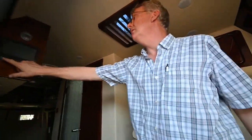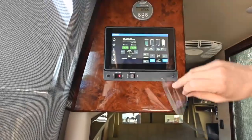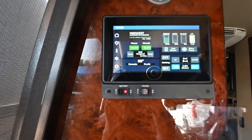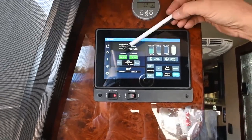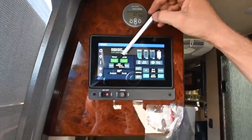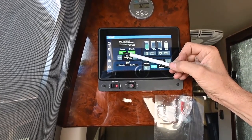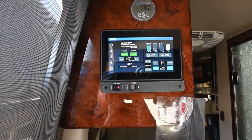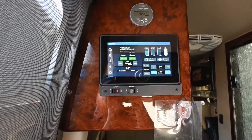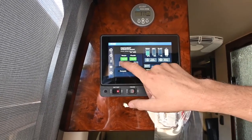I've got my main control panel up here. You've got a battery switch here - turn that on and you get power on the display. Looking at the house power and chassis power: the house is at 14.4 because I'm plugged into shore power now, so it's powered up well and charging the house battery in the back. The chassis battery is also at 13.5. If you ever get down to about 12 volts or 11.8-11.9 on the house battery, that's a pretty discharged battery - you need to plug in, run the generator to charge, or start the engine because the alternator will charge both sets of batteries.